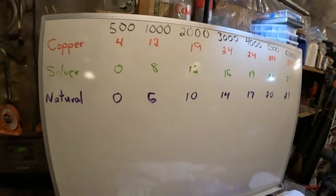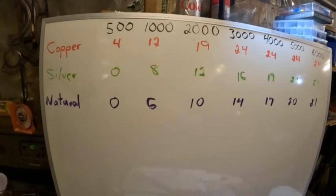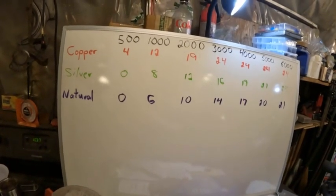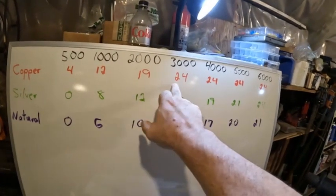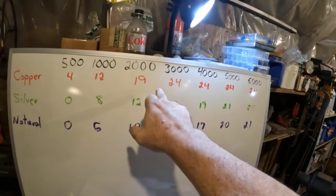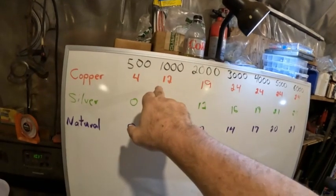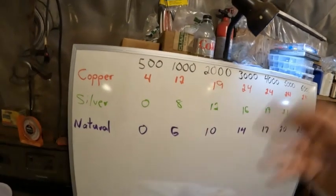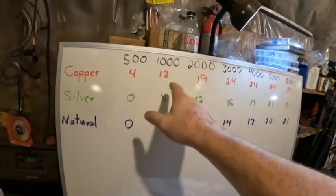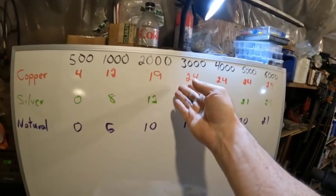That's why I say, personally, why do you need to do these things? The next question is, I'm thinking about a lockout distributor. Well, if you're putting in a lockout distributor, odds are you have a higher stall converter. So if this thing is already putting this much centrifugal advance in at between 2,000 and 3,000 RPMs and you have a high stall converter, when you punch the throttle it's going to be fully advanced. So why do you need it fully advanced down here and making it buck the starter and fight with the mechanicals of your engine? I don't really enjoy buying ring gears and starters that much. So personally I would set my timing and use the copper springs, and if you have a high stall converter you're going to have plenty of timing when the converter hits anyway.